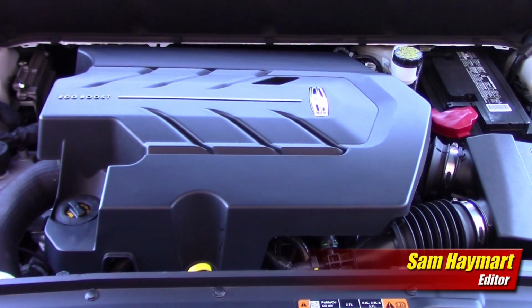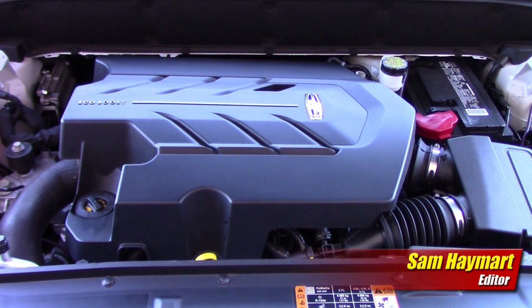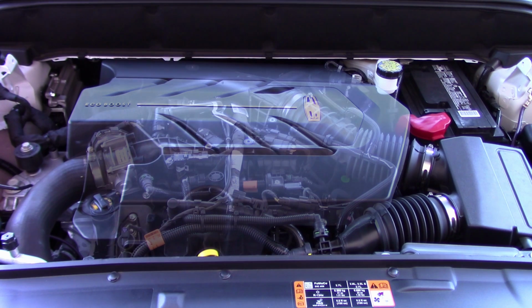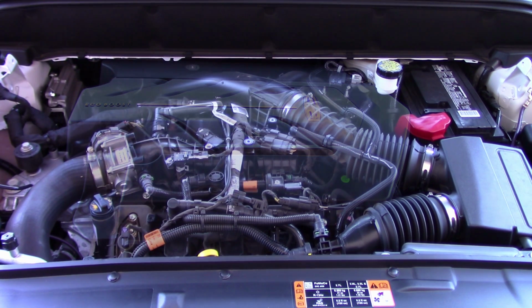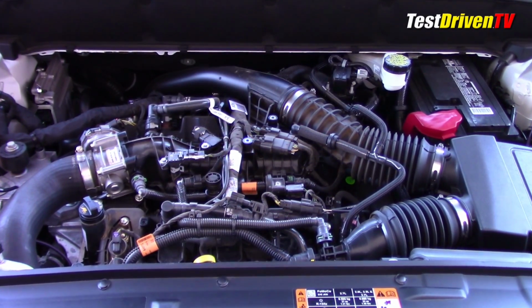Ford's 2.7 liter twin-turbo EcoBoost V6 first appeared in the 2015 F-150 pickup and then the 2015 Ford Edge Sport. Now it's in the 2016 Lincoln MKX, and soon they'll be putting it in the 2017 Ford Fusion Sport all-wheel drive. Here it has the highest tune of them all at 335 horsepower and 380 pound-feet of torque, driving its wheels through a 6-speed automatic transmission.